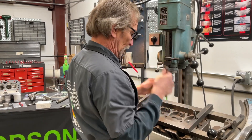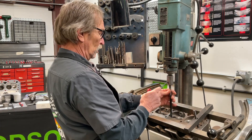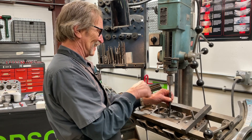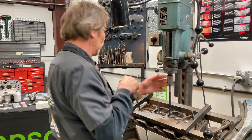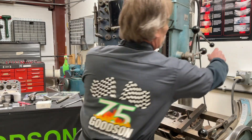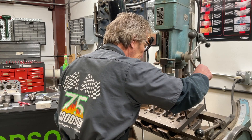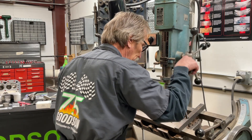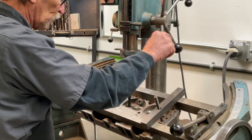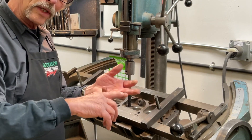Raise my head. Get my tool in position. Bring the quill around. Open up that chuck. Get some side pressure off of that tool. Lock him down really good. Now I can bring this over, bring my head over as well, lock that quill back into position, and then come right on down. Center on that guide with the pilot part of this core drill reamer. I like to leave the air on and move the quill up and down so I know I don't have any drag on that. I'm all locked down in this position.